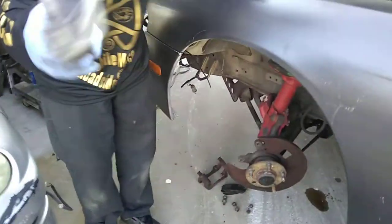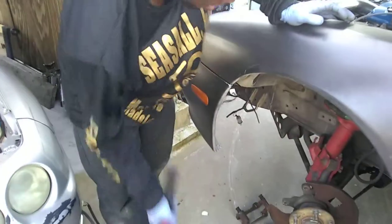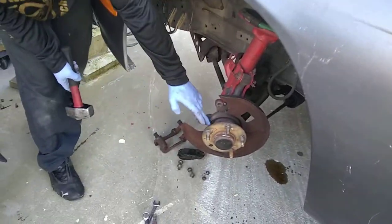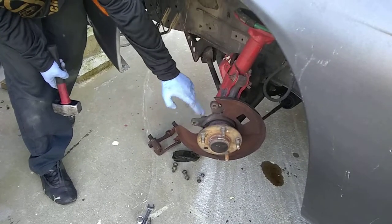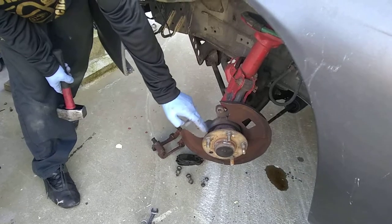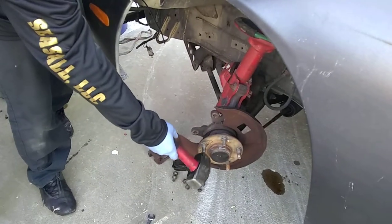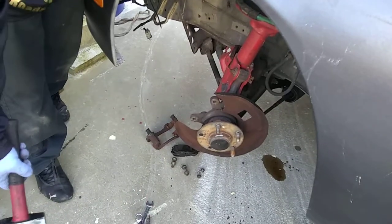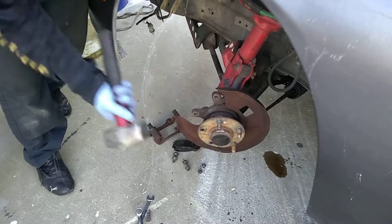All right. So what you're going to need is at least a 2.5 pound hammer. And we're going to find the stud. Typically there's going to be a space in between, right on the hub that'll let that lug nut come out. You find your lug nut, get a good tap. And there you have it — that is how you remove a stud.